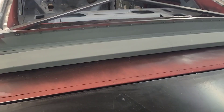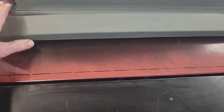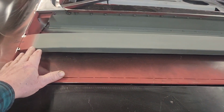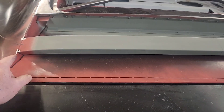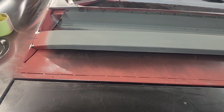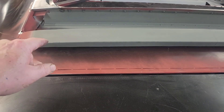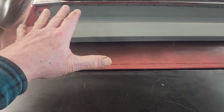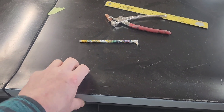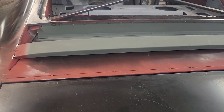Here's what it looks like with this brace in. It's 023, bent on both sides to create a C-channel and shaped so it sits just slightly below this rear panel. I'm going to put some seam sealer on before putting this piece down - it'll act as a cushion and a flexible joint between this and the upper panel so the two can move a little bit, just like you'd do for a reattachment of a deck lid or hood to its substructure.